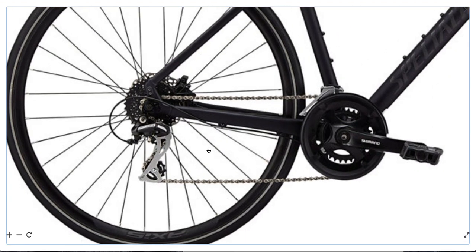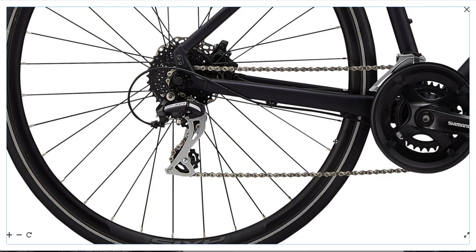Let's talk about the cassette. The cassette is Shimano, 11-32, which is pretty standard. The drivetrain has a pretty well balanced amount of high and low gears — you can easily climb anything and also go pretty fast. The combination of the 46/30 crankset gives a very similar range of gears to the typical hybrid triple crankset, which is 48/38/28. It's easy to find the right gear because they are much closer to each other and require fewer shifts. Specialized trimmed the very high and very low gears, leaving the rider with a simpler drivetrain that is easier to use, especially for beginners.